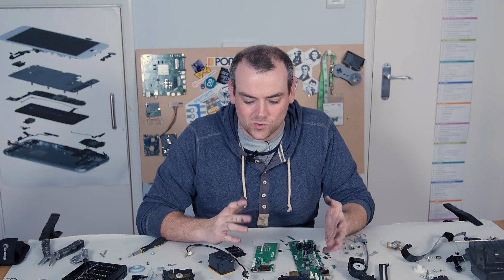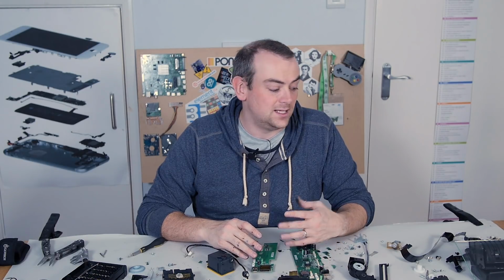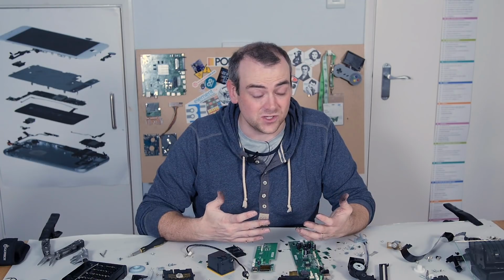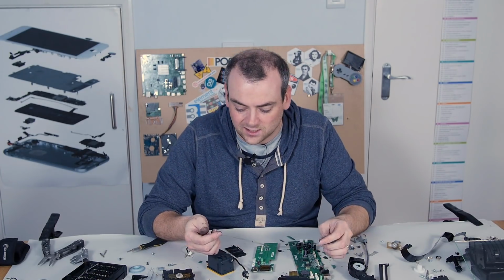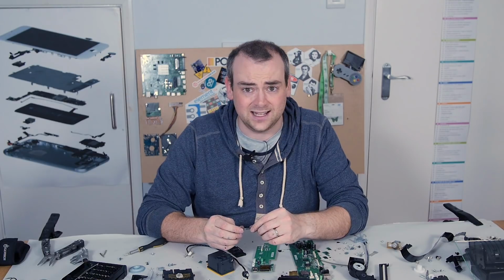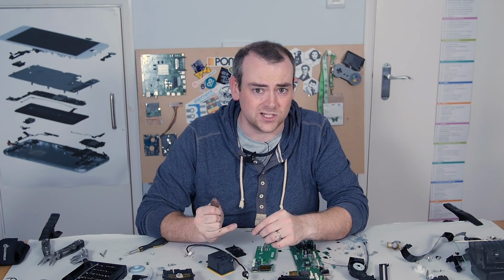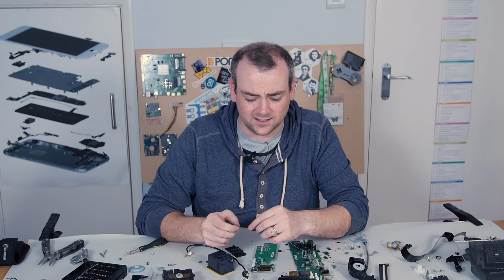But I think we've all been stung by buying a cheap inkjet printer, which has worked for a cartridge worth, 2 cartridges worth, and then for some reason has stopped working. Now look at the resolution on these encoder wheels and the fact that this one, which defines the carriage head position, has actually already got ink spattered on it. That's enough that it will no longer know when it's home. That's enough to stop this printer, that tiny little bit of ink.